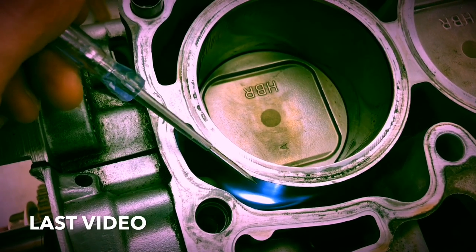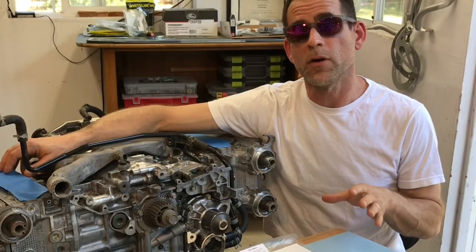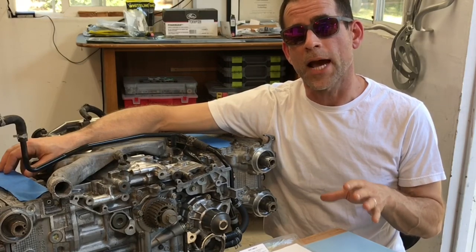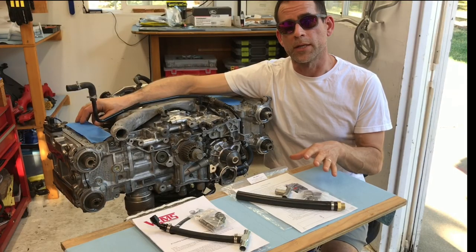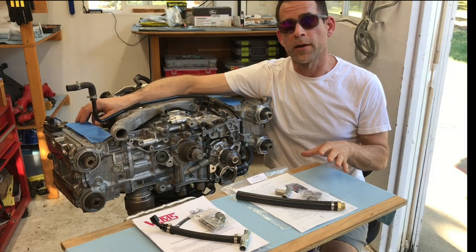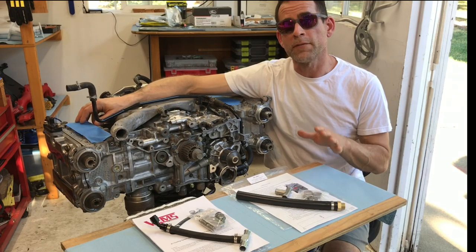Now that we've walked through how coolant flows through the short blocks of these engines, and we've taken a really deep dive into how the coolant flows through the heads of these engines, I think you guys can start to see why it appears that cylinder number four is actually getting inadequate cooling with that factory coolant design. That's why these reverse cooling mod kits on the market might actually be a really good idea to provide some protection for your engine and to maintain more even cylinder temperatures across all four cylinders.